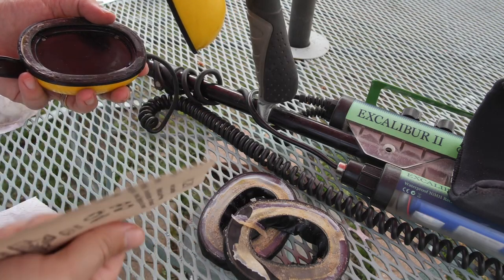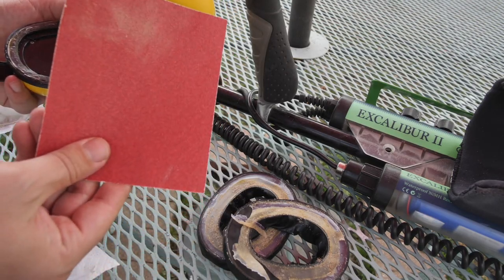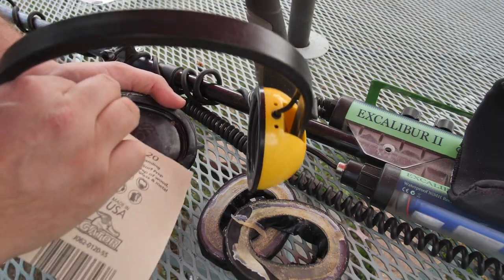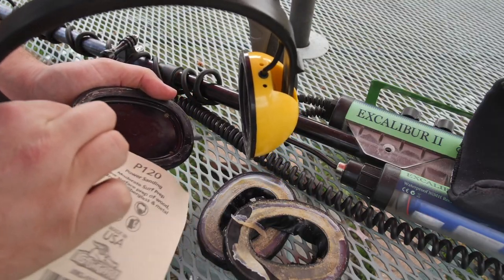Once you've done that, go ahead and grab a little bit of sandpaper. You're gonna use that to get any extra old dried glue off of there, as well as any final sand. It's also going to help rough up the plastic just enough so that when you put the AquaSeal onto it, it's gonna help fill in and bond to the backing of the headphones — and that's important because we don't want those headphones to slip off.